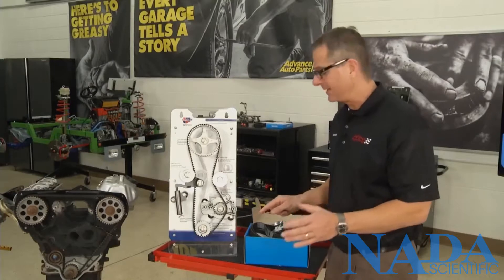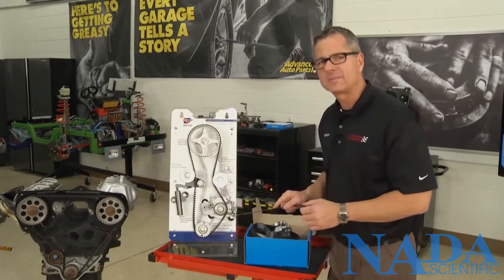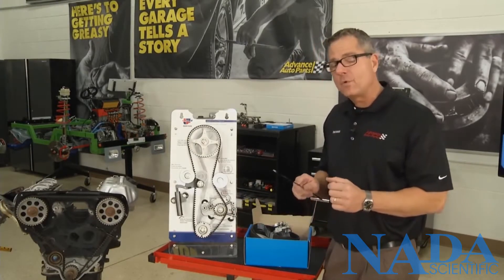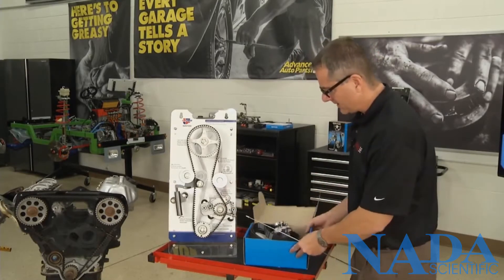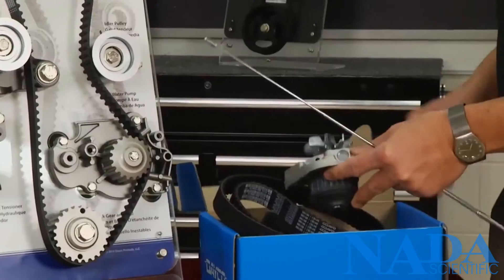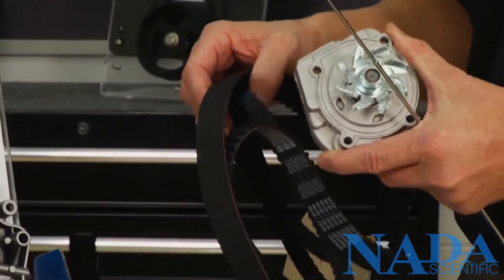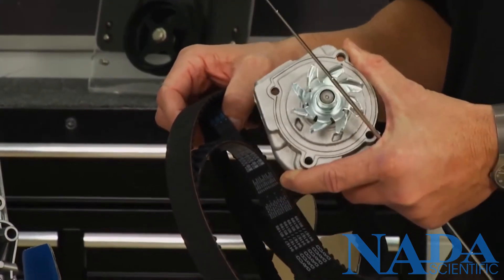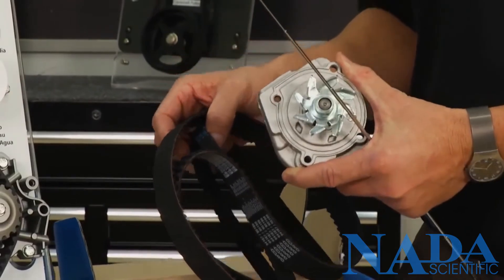Think about that for a minute — it drives a water pump, so if your water pump is leaking it could get on the belt and you could have problems. This is a difficult job; you have to tear the whole front of the engine down to get to this timing belt, so you can get a kit like this. I highly recommend you go ahead and get a water pump and timing belt whether you need one or not, because over time your water pump is going to fail and start to leak, and if it leaks on the belt it may jump one or two teeth and you could end up with catastrophic engine damage.